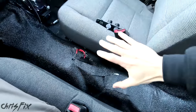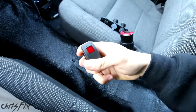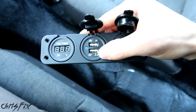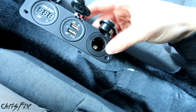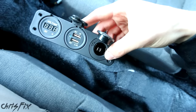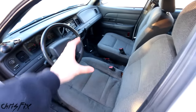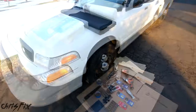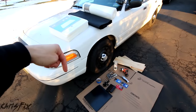We're also going to make it so you can open up the top and have storage inside. In this center console, we're going to add switches, and I'm going to show you how to put switches into the center console — maybe you have stuff you need to wire in. Even better, I'm going to show you how to add USB charging ports so you can charge your phone and electronics. It also has an extra cigarette lighter, so you can use one of those cigarette lighter power adapters. Building a center console is a lot easier than you think, and I'm going to show you all the supplies you'll need. Any products or tools I'm using in this build, I'm going to link in the description.